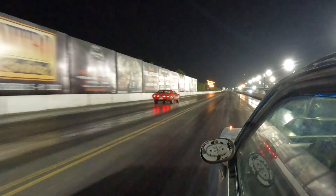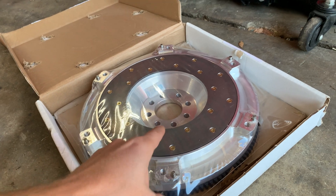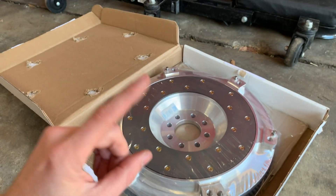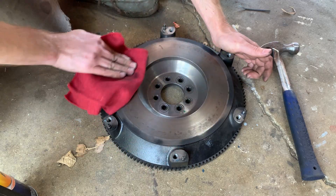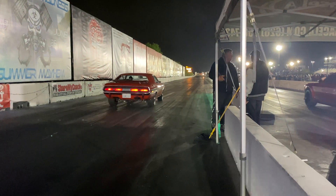Check out this lightweight aluminum flywheel. I can't remember the exact weight but I'm going to guess it's something like 11 or 14 pounds, so this should shave off about 10 or 15 pounds from the stock flywheel. I will be weighing both so I'll know for sure how much weight I'm saving. If you read online about aluminum flywheels you'll find a lot of debating about whether it's better or worse, whether it makes drag strip launches worse or makes track day and autocross driving better. I've certainly been down that rabbit hole.